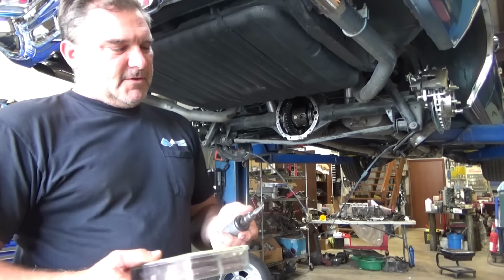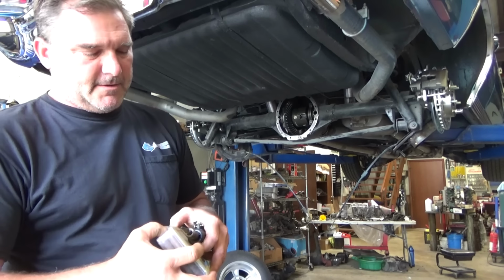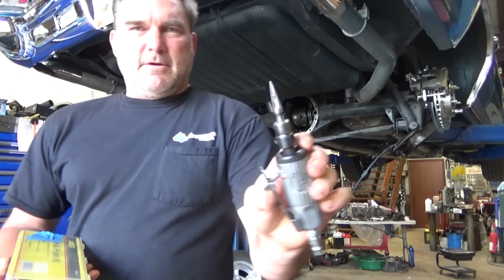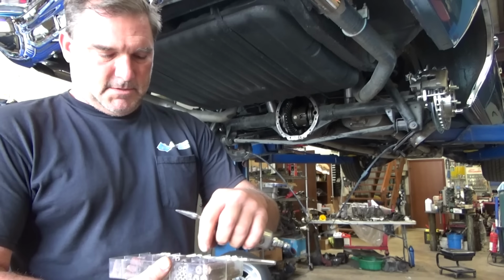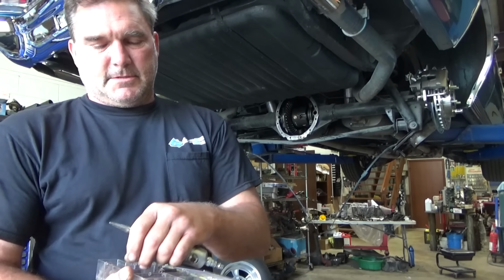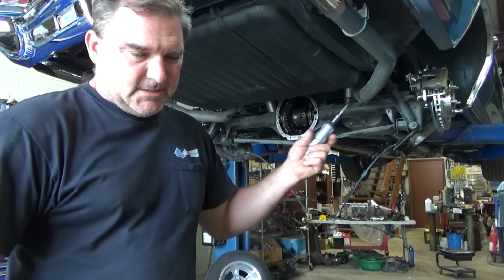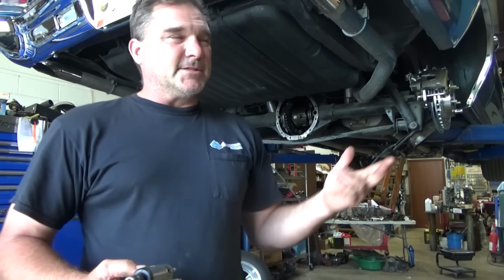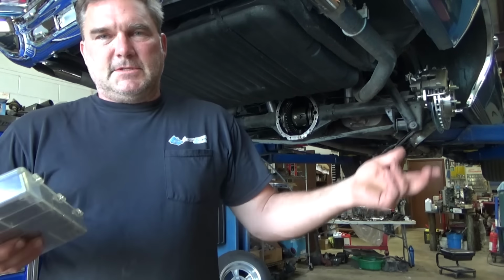So to answer Austin's question of what a fella would do at home if he ran into this problem with the brake rotors, well, you would either use a rotary tool with a carbide bit and open up the hole in the rotor, or use a Dremel with barrel sanders or a stone. In this case, it's not that big of an interference, but it's enough to be a problem. I still chose to modify the axle because it's just easier long term.